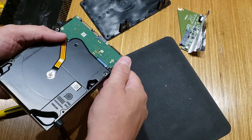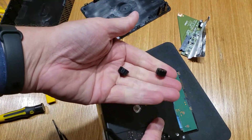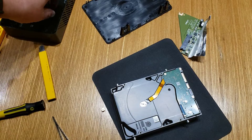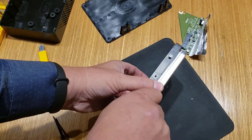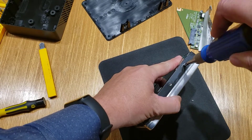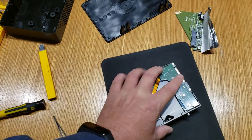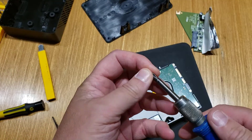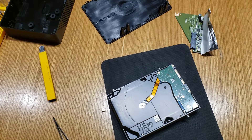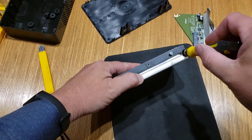These just pop off — they're just little rubber insulators that provide some shock absorption. If you want to bolt it into your system, these just come out. I can use a standard Phillips screwdriver — though they're a little smaller, so this is probably a number two Phillips and I'll have to go to a smaller one. For the sake of expediency, I'm going to use my specialized tools here, but you probably don't have to — you probably have a smaller screwdriver.